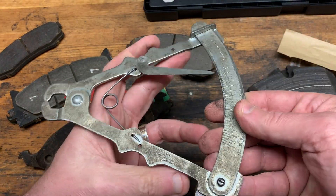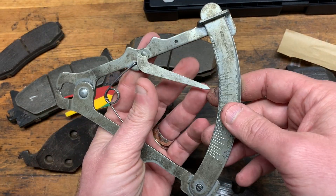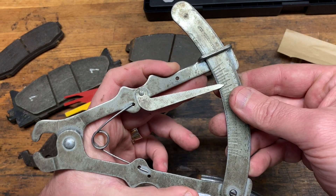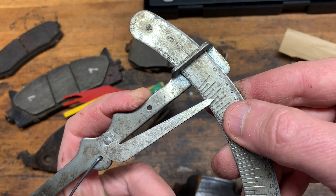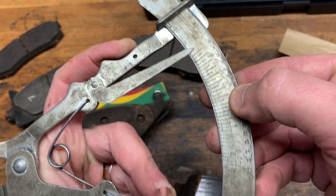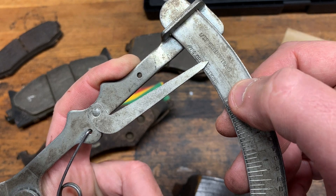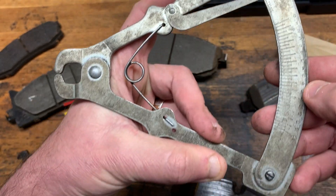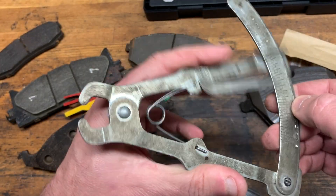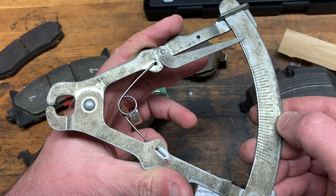The next tool looks like an ancient compass — a sextant used to navigate the seas. No, I'm just kidding — it's also a brake depth measurement gauge. This one measures in 32nds of an inch, and actually also has 64ths of an inch graduations, going from 0 up to about 16. So we've got 32nds at the top, 1/32nd inch graduations, and 1/64th. It's old — Made in USA — but still has value. It doesn't do metric, but it's what the state wants.